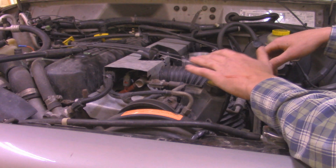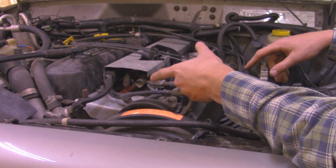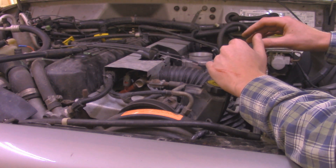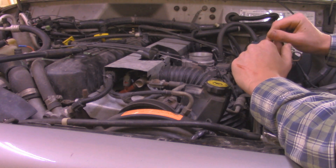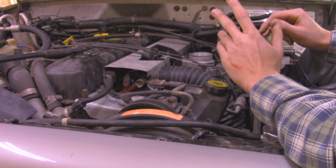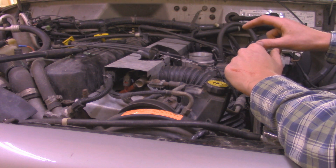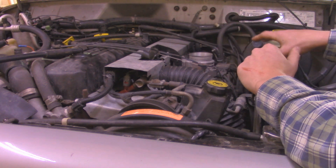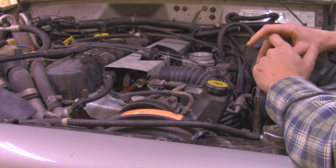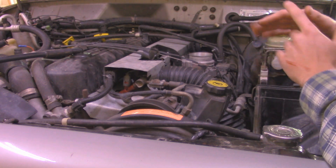In the near future, I'm actually going to remove this whole entire cooling system because I actually got 12-hole injectors. Those are basically not prone to having vapor lock at the temperatures that are in the engine bay — people say it solves their heat soak issues. And another thing is I got rid of my pre-catalytic converters that are right after the exhaust manifold. I basically just got a Federal Emissions Y-pipe and replaced it right there. So that should help keep the temperatures down in the engine bay quite a bit. I'm going to drive the Jeep a little bit and warm it up and I'll show you how it works in action.